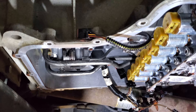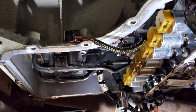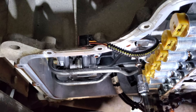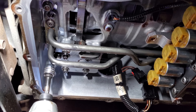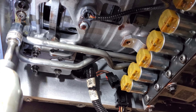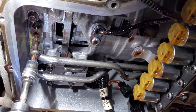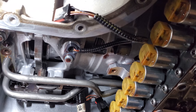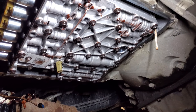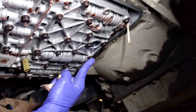This is a T30 Torx. We have three of them — this one here is securing the valve body feed tube to the actual trans case. They all look like they're the same Torx, same bolt, same length. This is going to have fluid in it so be prepared for some to start leaking. This one leaked overnight, so that may be why mine isn't as messy as yours. Here we go — going for this one, this one, and this one.